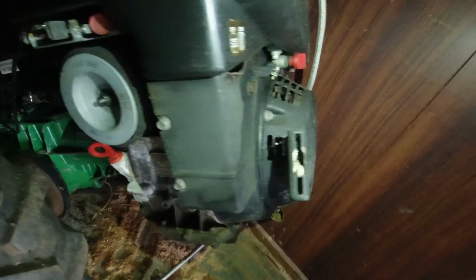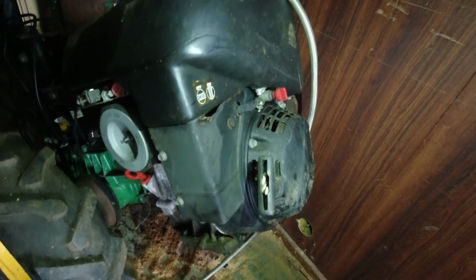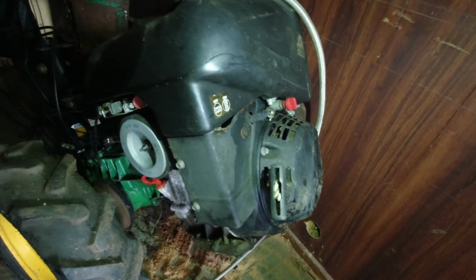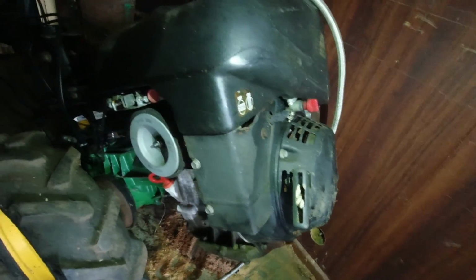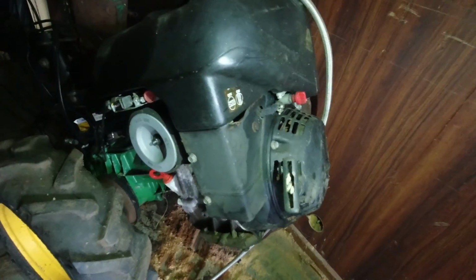When you put petrol in, of course, it absolutely pours out everywhere. The rubber has gone and split and perforated. So my goal today is to simply change the fuel line. I've got some secondhand stuff off my brother, off his race car. We're going to change the fuel line and see if we can get this thing running. So if I know the engine works, then I can test the gearbox and then we can test the clutch.